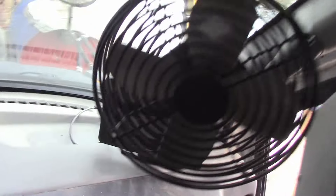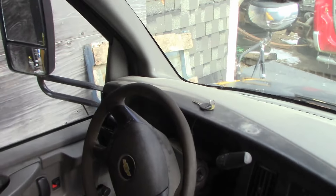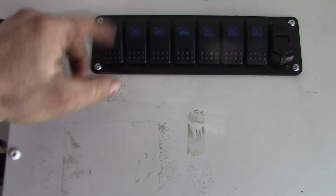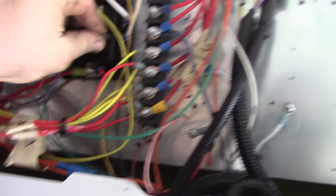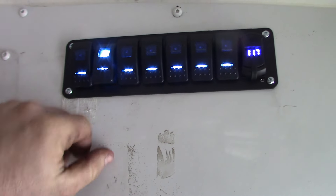There's our backup camera set up there. I'm not going to start the bus because it's probably negative 10 today — I don't want to hard cold-start it. We got all this set up: this one is front reds, front yellows, back yellows, back reds, back yellows. I have it so it doesn't kill the batteries but gives you a voltage readout, and you can turn on some of the lights and they all light up outside.